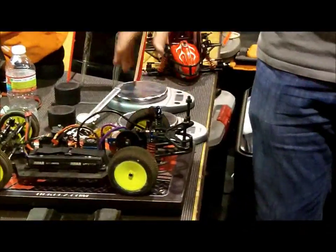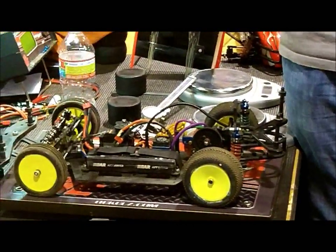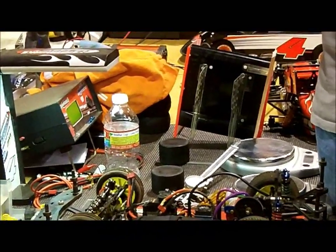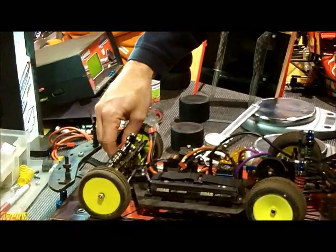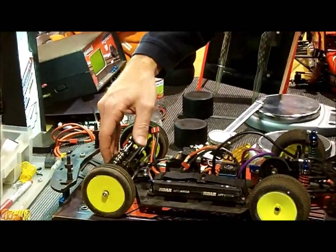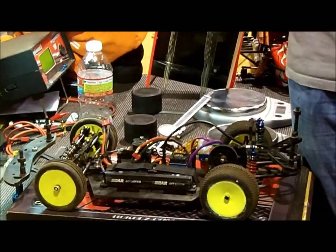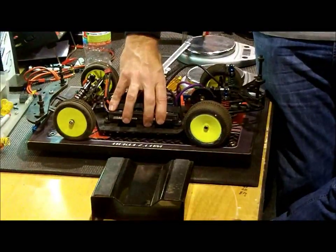The way it goes, and I think this is the trick on what he was asking for at that moment, is if you turn this collar down, you get all one direction help for curing loose, as long as you've got travel for it to go down. If it's not sitting down in the spring, turning that collar is only going to preload the spring. It's not going to jack any weight. It's not going to change anything. And that's where you see a lot of people get frustrated when their cars aren't sitting down into their springs.